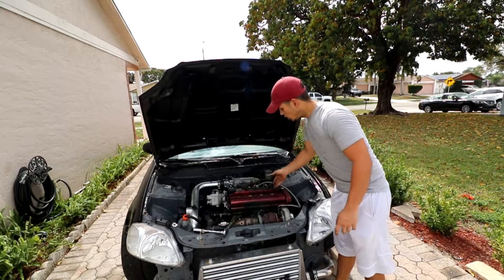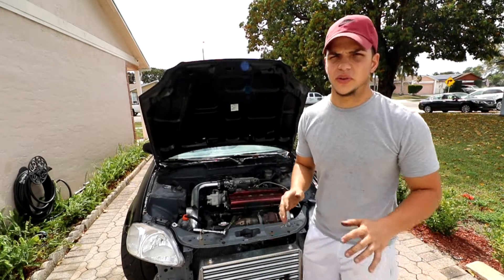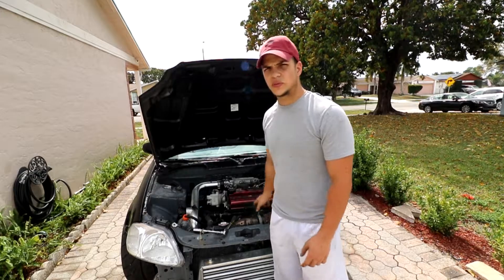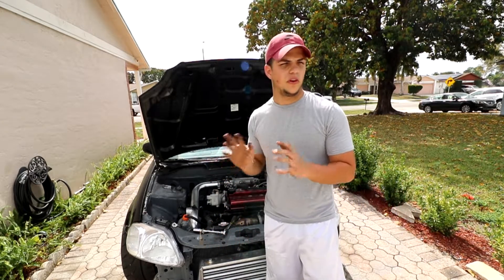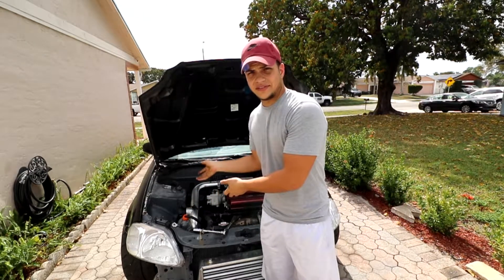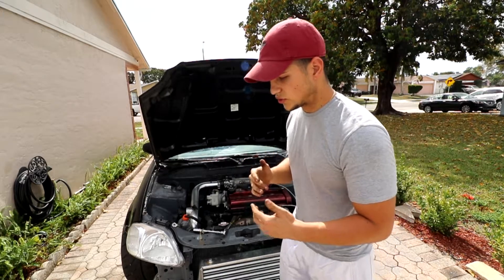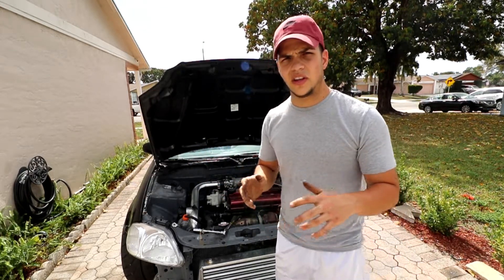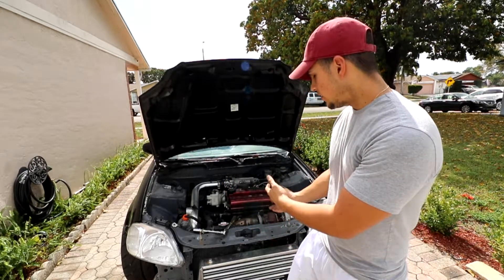She just made a big smoke cloud. When I got home I saw smoke coming out the PCV pipe, and I thought maybe the ball just got stuck — that happens a lot. But to confirm my suspicion, there's only one way: I believe I cracked a ring land due to the rings not being gapped correctly for boost. It's a completely bone stock motor.